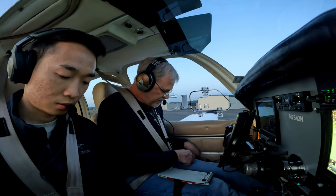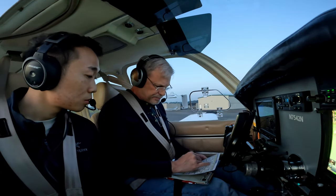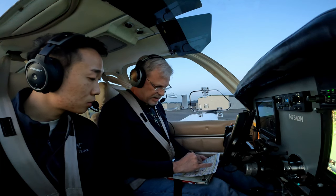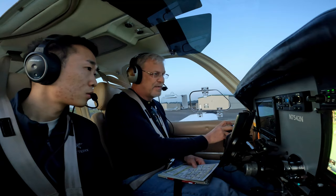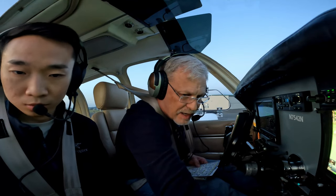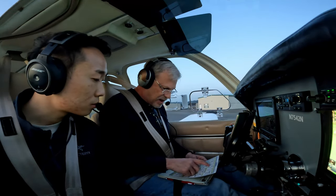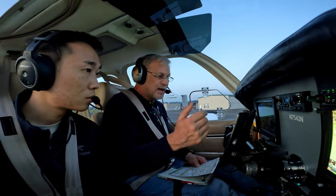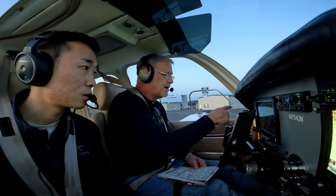I feel good about that. I've got everything I need here. I'm going to now check my run-up. Fuel was on the proper tank. Yes, it's still on the right. The electric trim, I've started adding it, just to show that it disconnects, but if it doesn't, there's autopilot and pitch trimmer over here. Okay. So, I can tell that it's off. I already checked the lights when I did the pre-flight, and that was already on.